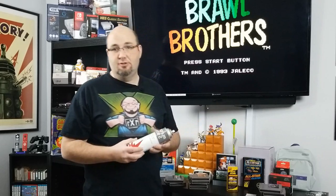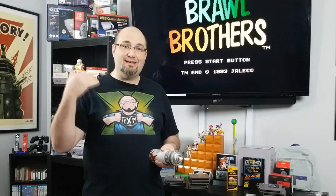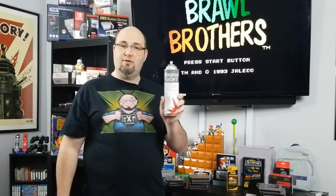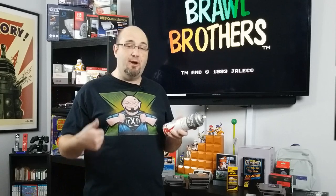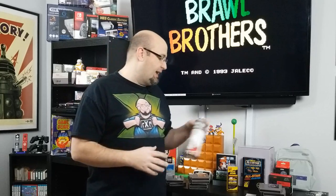You're also going to want some cleaning solutions. A lot of people use alcohol — I can't say not to use it, it does work well. The higher the percent, the better, because you have less water content. I actually use Magnum Force 2 from a company called Dynamite — it's actually one of the brands for the company I work for, Horizon Hobby. They have not endorsed or sponsored this content whatsoever; this is just honestly what I use. It's a cleaner-degreaser designed for RC models and works great on ball bearings, electric motors, and electric contacts — that's where it comes in handy.